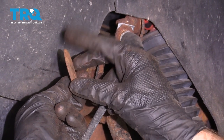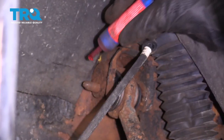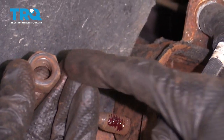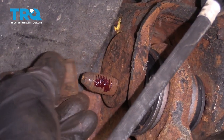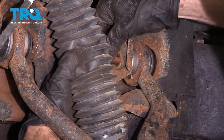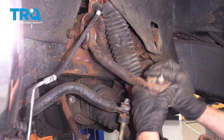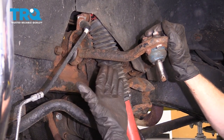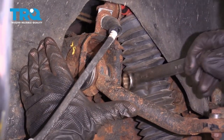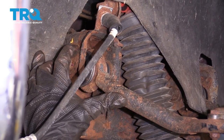Let's go ahead and install our cam on this one. We've got the beveled area — we want that facing in. Apply thread locker and start your nut on there. You have the locking side and then the flat side; you can tell which side was up against the frame. Do the same to the other side. Before we can continue tightening this up, we need to have it at the normal ride height level — approximately level with the ground. Make sure that our cam bolt lines up with our lines, then snug these up and torque them to 140 foot-pounds.